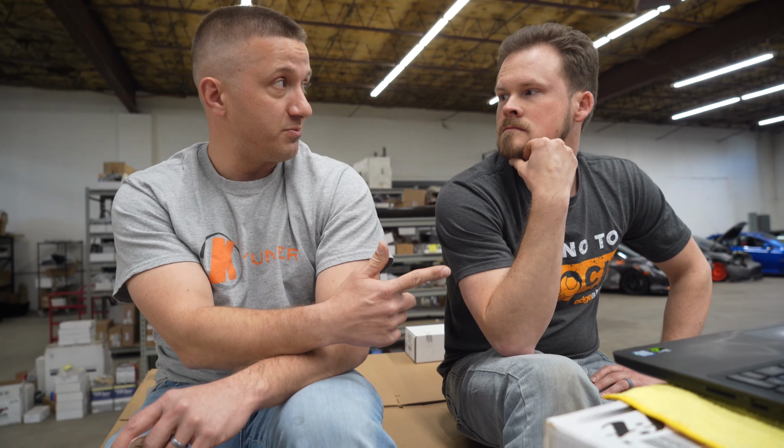Yep. It's not even really that hot. So cooling immediately becomes the weak point after you put on brakes on the car. And by the way, just to give you an idea of how much you can push the car on upgraded brakes, the highest I got on oil temp last time out on like a 2 or 3 lap session was 235 or 240 on oil, something like that. I think you might have gotten to like 215 or 220 on coolant, and I don't remember what oil was.